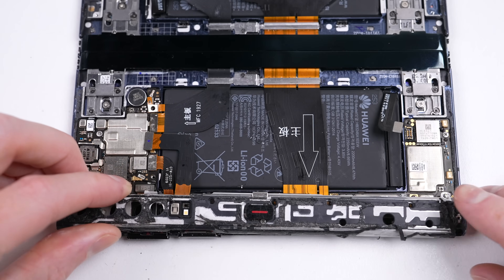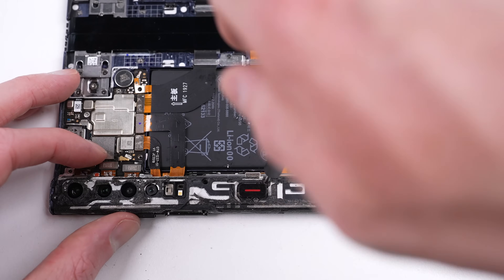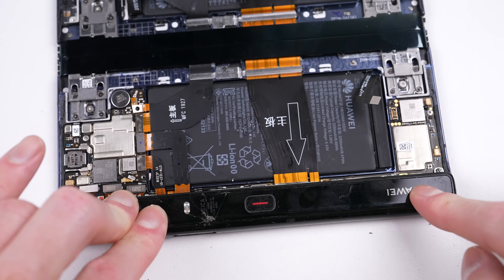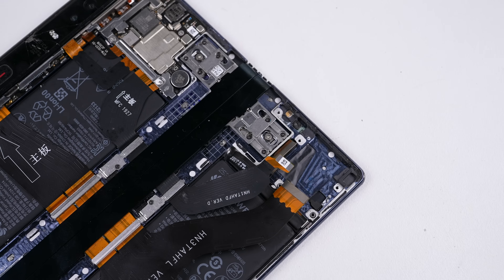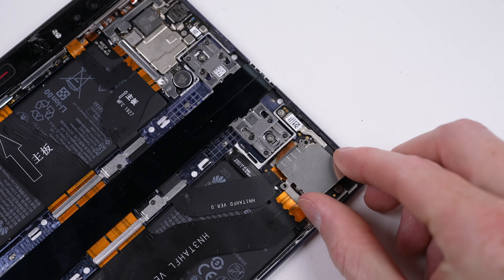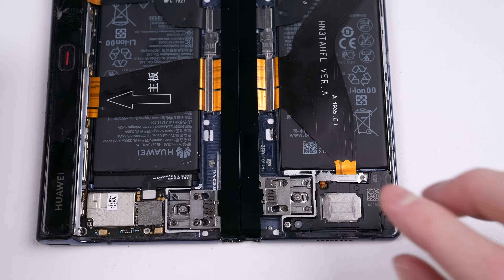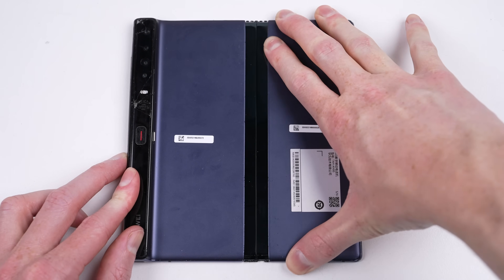With the motherboard and cameras back in, it's time for the antenna. Those non-magnetic screws are really giving me a bad time. The lack of magnetism is likely due to the folding aspect of the phone — there is probably a magnetic sensor to detect the position of the screen, whether it's open or closed. Magnetic screws might interfere with that system, so while annoying, it stands to reason. Next to go in are the metal brackets, which are clipped and screwed into place. After which, the SIM reader can be reinstalled and have its several flex cables reattached. Once its brackets are back in place, I can move down to the lower portion of the phone, where I can install the speaker and its appropriate hardware. After reconnecting the battery, the last thing left to do is reinstall the two rear panels. Of course, if this was a repair, we would attach some adhesive first.